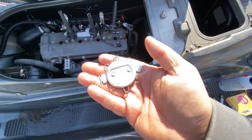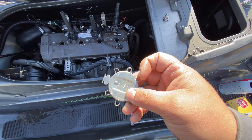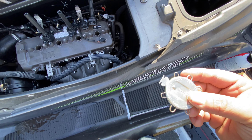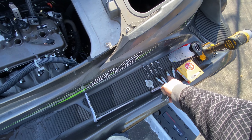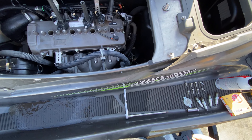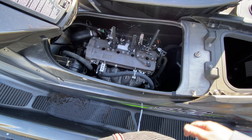I've got these gap gauges — pretty old school. I think the new ones are round with an increasing gauge on them. I'm just going to gap the new plugs, and these are the old plugs. Put the new plugs in and it's just the reverse of everything before. I hope this video helped you guys — like, comment, subscribe, all that good stuff. See you guys out on the water.